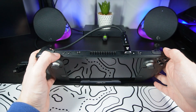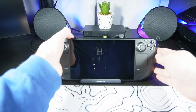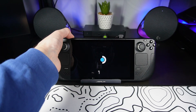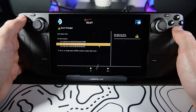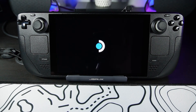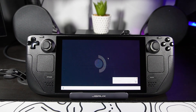Once it's connected, hold the minus button and then press the power button, and keep holding the minus button until you hear a sound from your Steam Deck. Then let go and wait for the boot manager to load up. Once you can see it, your flash drive should be listed as a boot device — select that using the D-pad and the A button. You may need to wait several minutes staring at the Steam Deck logo, and then a black screen with a mouse cursor, but it should eventually boot up into the live USB version of SteamOS.